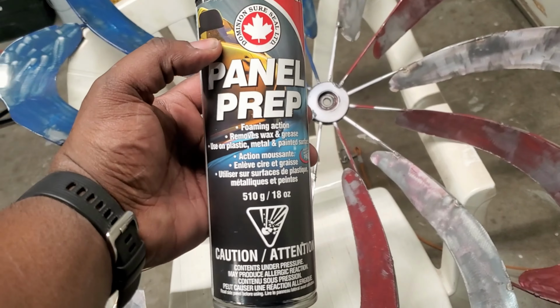Outside being weathered, we're just gonna use some acid etch primer, and I'm still gonna epoxy it and high build prime it. I just wanna put as much protection over it as I can. It's just in a spray can, IMP 130 acid etch primer. So let's get it primed.